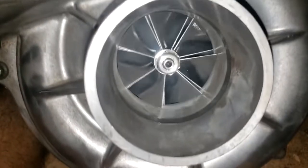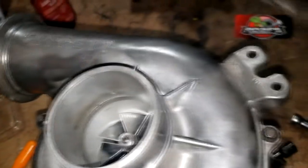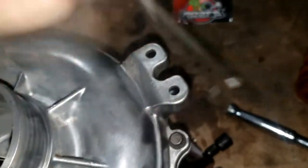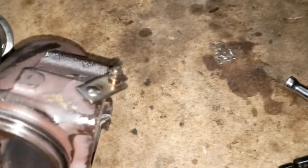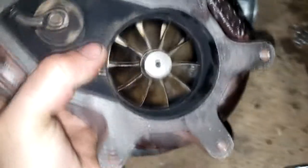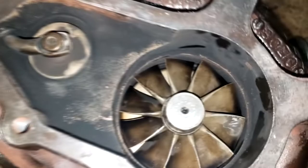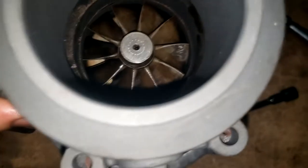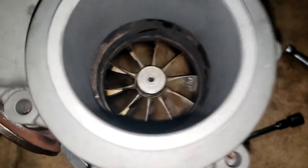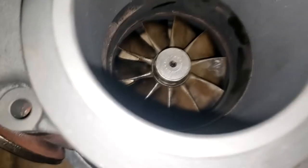Because the wheel spins freely, this is a successful install — pretty straightforward. Now let me show you the high flow outlet. The wastegate actuator and the two bolts can be done shortly, but primarily the most important part right now is the high flow outlet. Once you get this guy right here, it literally just aligns and seals with the bolts. You can see it has a straight path with no flap preventing high-flowing exhaust from coming through.